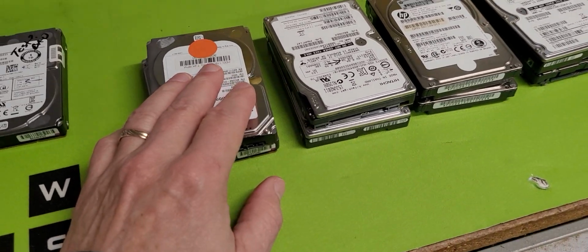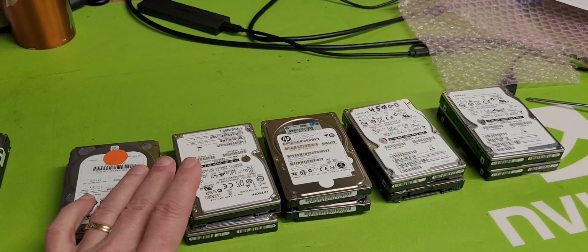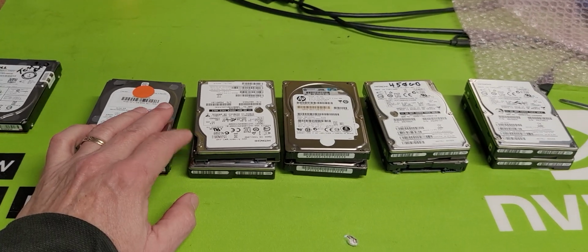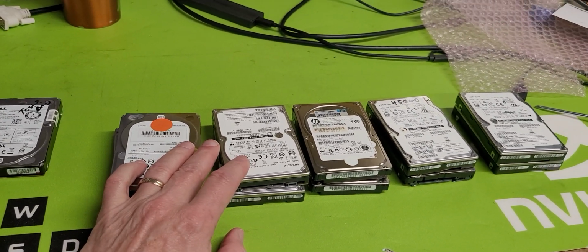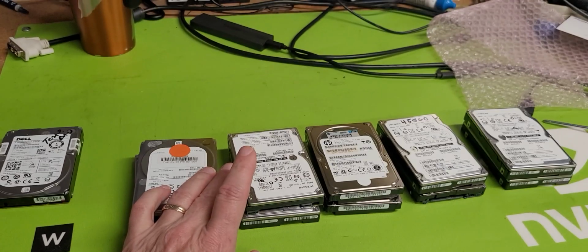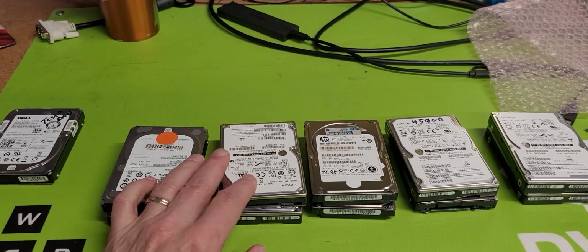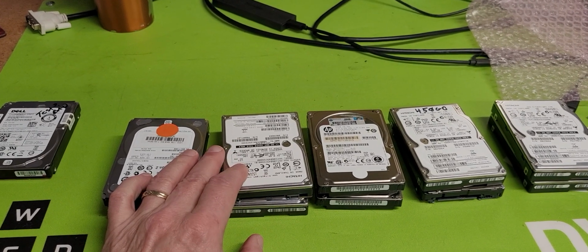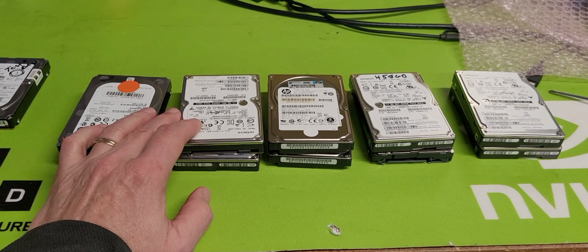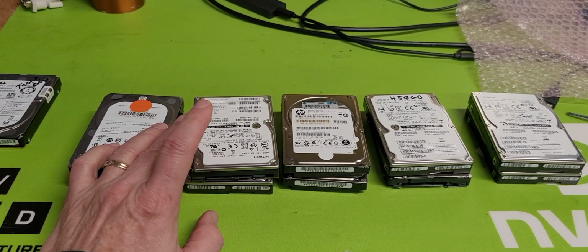This is on a different RAID controller. And when you're building your pools, especially when they're similar disks like you've got in your system now, you have to remember a very crucial detail. And that is, you do not build pools across different controllers. In other words, you have an HBA controller on the back of your 720 connecting to a disk array, and you have a RAID controller inside your server that is connecting to the internal disks. I've seen this happen, and unfortunately, it's happened on hot swaps, where people just grab a drive that they find out there, but they didn't research where the disk sat. And the next thing they know, they're saturating both their HBA controller and their RAID controller heavily with way out of control I/O. And what's going on with those IOPS is you're trying to run performance level data writes and reads across two totally separate storage platforms.